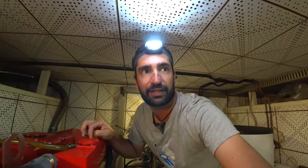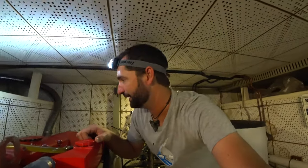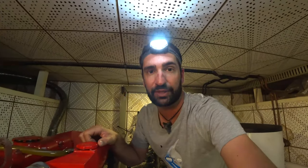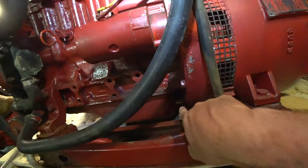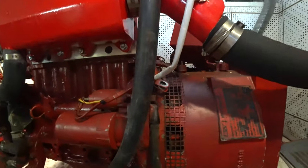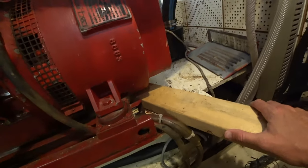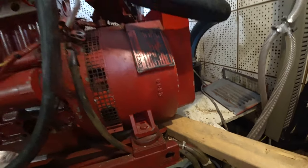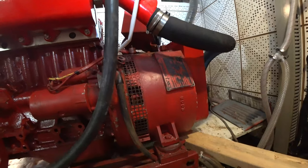So when we get to putting the armature back on and putting everything back together, I know where everything goes. I've had it too many times where I don't know what bolt goes where and I end up with extra pieces or not enough. So I'm going to avoid that as much as possible. Next, I'm disconnecting the main bolts all the way around to release this back end—I'm sure I'll have to pry it to break it free. I have a piece of wood here supporting the back end so that when I do free it up, it's not going to weigh down on the armature or any of the other sensitive parts.